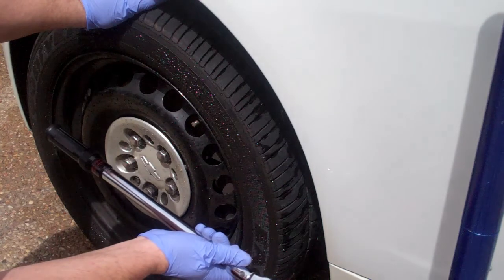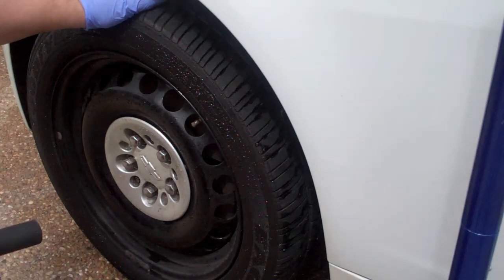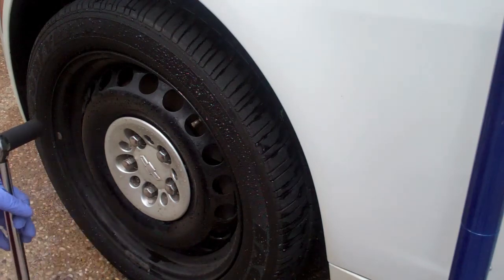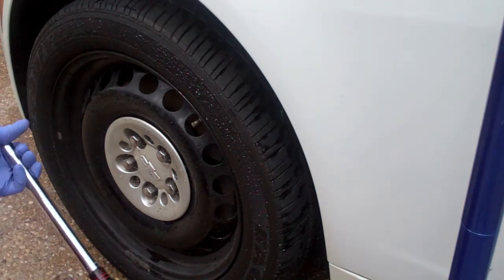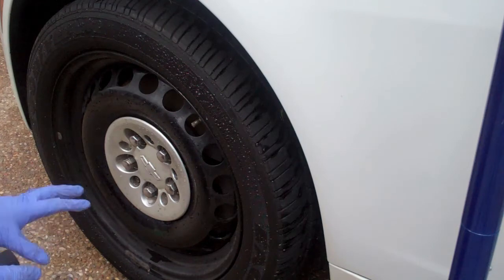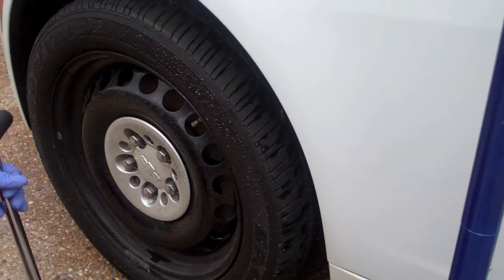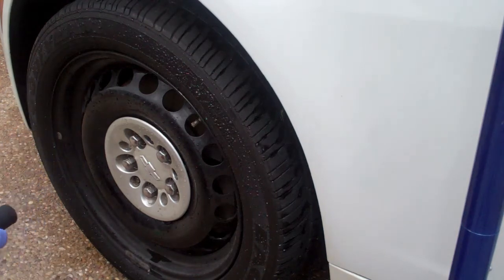Now, my torque wrench is set to 140 foot-pounds, which is what this vehicle requires. It's like a bone-breaking amount of force. That's what it calls for. Now some of you out there are going to say, well, your torque wrench may not do exactly 140, it's not NASA certified, whatever. I've heard stuff like that. It's not so much important. I mean, obviously it'd be ideal to get exactly 140, but let's say this is a couple foot-pounds off, and so it only torques to 135. Well, the main thing is having an equal force on there. So using the same torque wrench to tighten them all down, you can have an even amount of force. Now obviously if this thing gets far enough off to where it's not tightening down within a reasonable amount, that would be a problem, but so far so good.